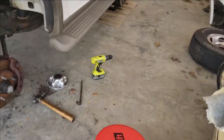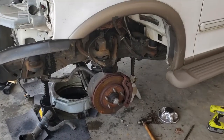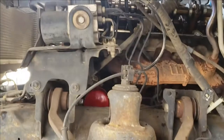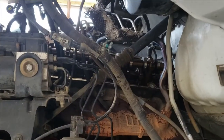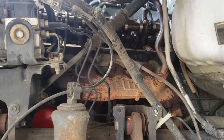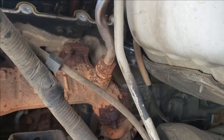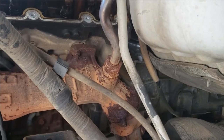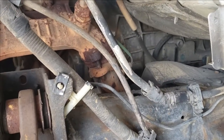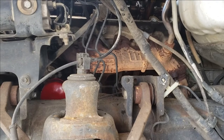For us old guys, I'm going to recommend going ahead and removing your front wheels — jack it up, I've got two sets of jack stands on each side. Remove your front wheels and remove that splash guard in the wheel wells. You don't have to, but it gives you better access to work on this side of things. Next step is to spray some penetrant on that and try to get that broken loose, then remove the exhaust pipe from the exhaust manifold and get the radiator out.